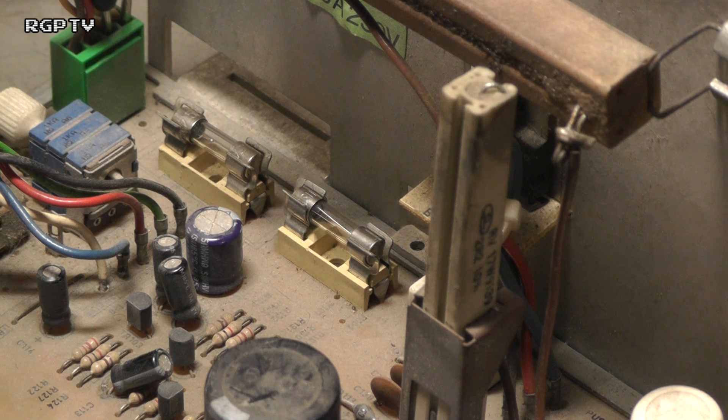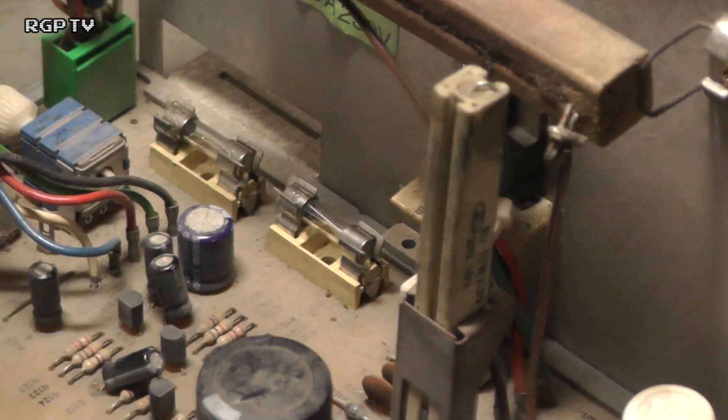I've lifted it out and reseated it, adjusting it slightly to make it a little bit tighter, and it now grips the fuse exactly as it should. It works perfectly well again. The meter showed 252 volts, which is basically the voltage getting to the power side of the chassis, so this is now going to go back into its machine and back into service.